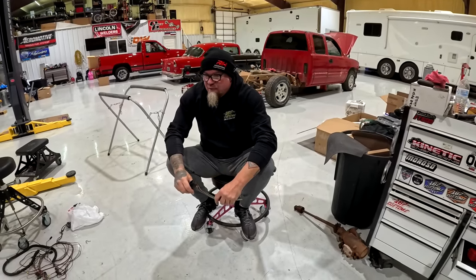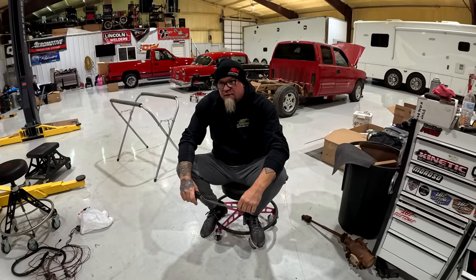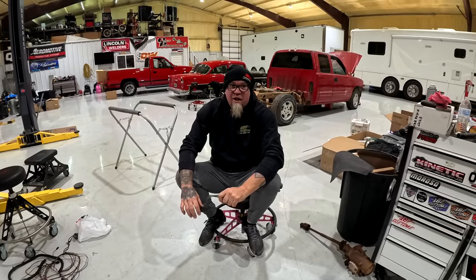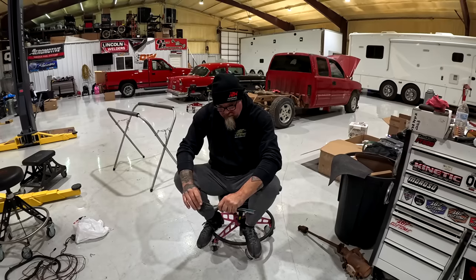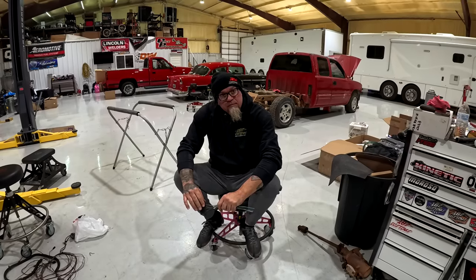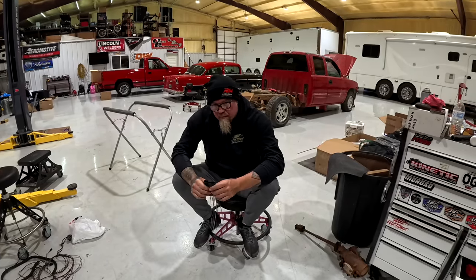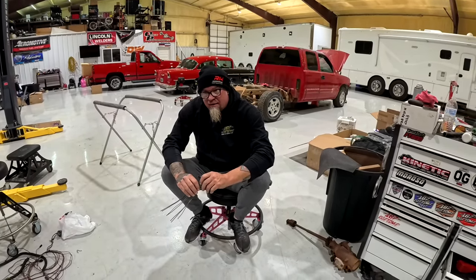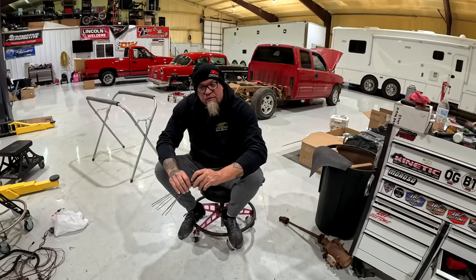So we ended up having to go up on the two-step because it wasn't happy. We also tried to leave in third and it did not like that. Didn't work. I've seen some people do that. I'm sure you can make it work with the right converter. Ours seems to like to leave in second. He wants to put a looser converter in it. That's what he had said.